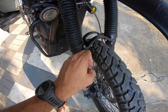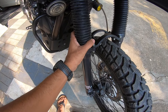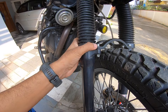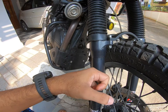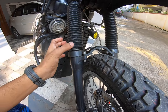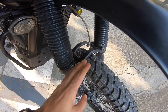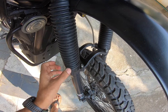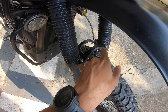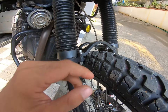What you can do is start clamping down the bolts one after the other to slowly compress it into place. The best way is to clamp diagonally — alternate diagonal opposites — and slowly tighten them down. Once it sits, it holds the gators in a very nice, tight fashion. I thought I'd have to run a zip tie to hold the gator to the fork leg, but the fork stabilizer is holding the gators in place nice and tight, so that's the end of your worries about the gator coming off the fork leg.